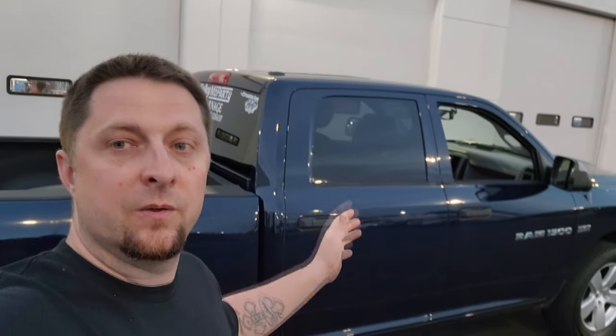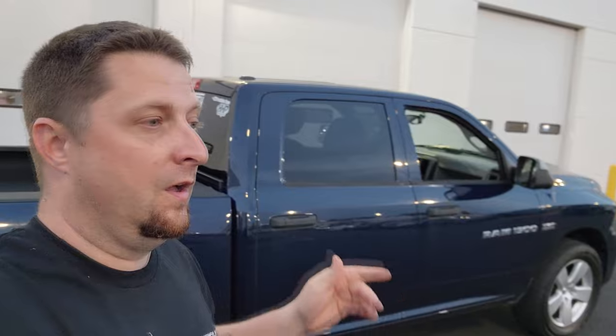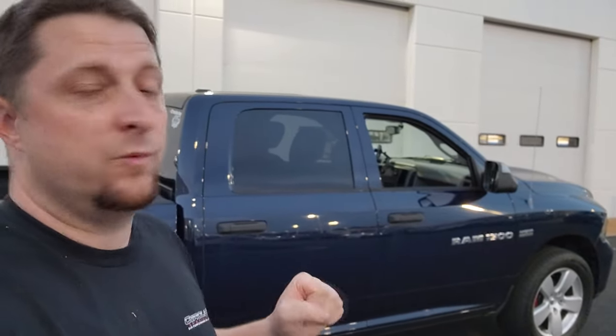All right, guys, we got the modified fuel hat back in Project Storm. Got the Holley in there, and we just went out for a little test drive, make sure everything's going good. So far, so good. We did give it a little bit of a throttle whack down here on a back road, and per the wideband, we went pig rich. So if you know, on the last video, we did some logging, and we found out we were going too lean. Well, it was going pig rich. It was going 10 O's under wide open throttle, so we definitely have more fuel now. So we should be probably pretty good. So now we gotta start dialing and taking some fuel out and get our fuel back where we need to be, around that 11 and a half zone, and Storm should be a runner.